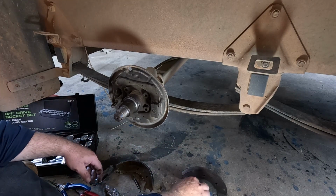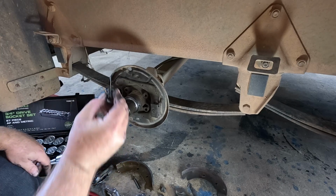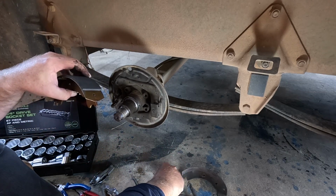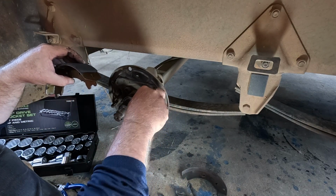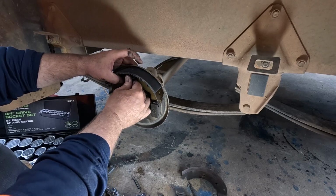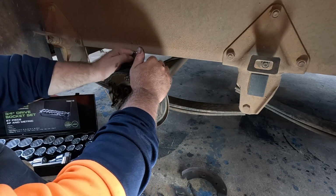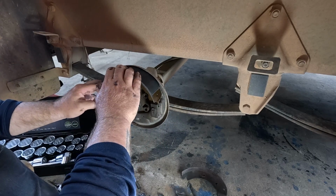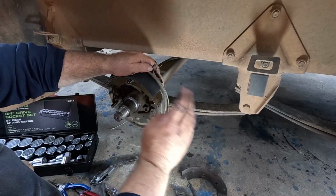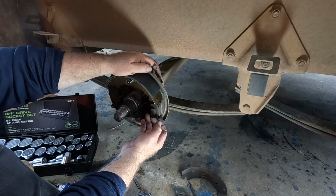So I reckon I'm probably gonna start with this top one, because that spring that goes through there, like I was saying with the hook, so that goes through there. That'll at least hold that brake shoe on while I can try and get the other one onto it. Alright, through there. Okay. That is down in there. Need to put that up there.